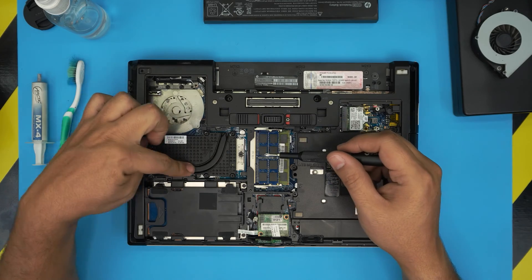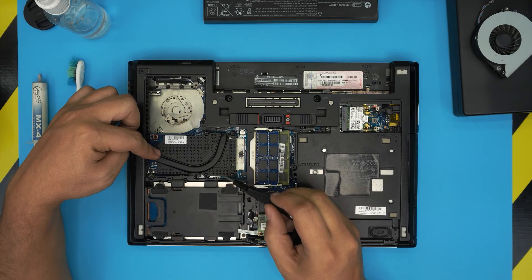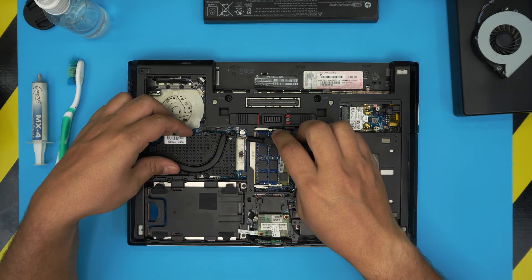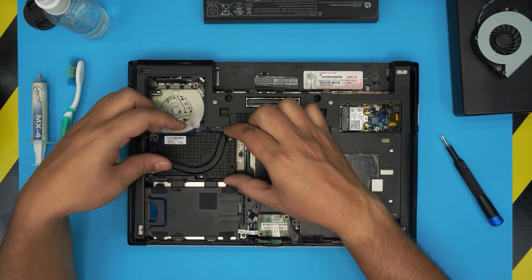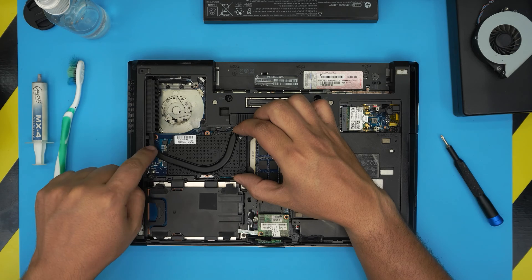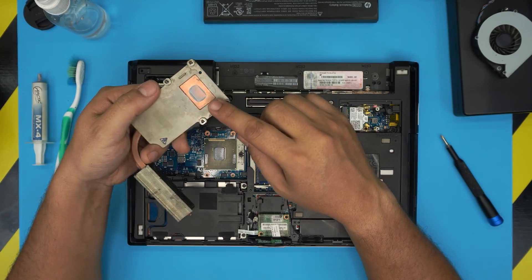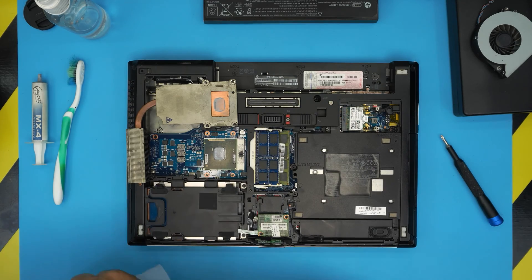Once you've removed the excess dust, remove the heat sink. Again there's a C-lock on these four screws, so loosen them up. Once loosened, lift the heat sink about 10 to 15 degrees and slide it towards the RAM — the whole heat sink will come with it. Don't pick it up too much or you'll bend the tubing; just gently bring it out at 10 to 15 degrees and remove it. This one was recently repasted.